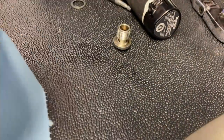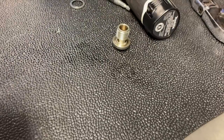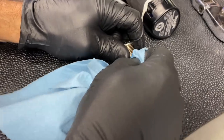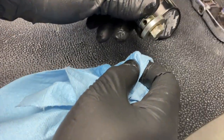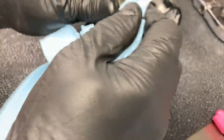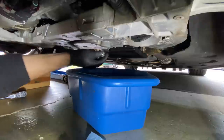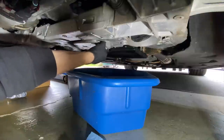Here's the factory drain plug — I'm cleaning it up and installing the new sealing washer. It may look a little too big at first, but notice that taper toward the bottom — it's concentric and sits right in the middle, sealing properly. I have some mineral spirits and a rag to clean up the bottom of the oil pan where there was oil residue. I also like to remove the old paint dab from last time — a little mineral spirits takes it right off. Then I'll index it fresh and torque it, and we won't have any issues.